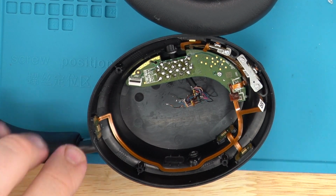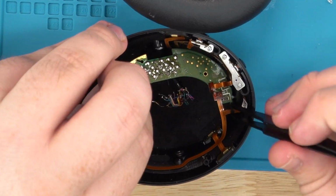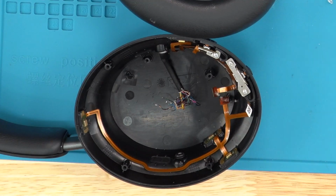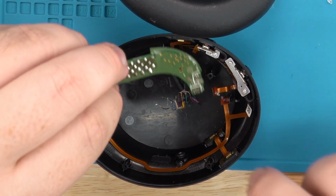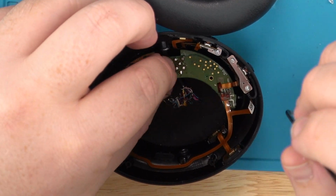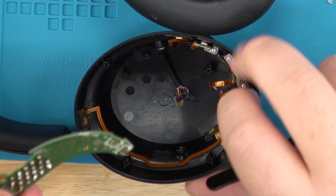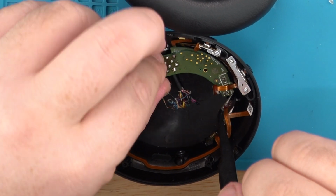Back to the video. It is very annoying, but once you pop that off, you have 1 screw to take off. And then that pops off, glue there, just like that. And here's your right side main board. Take that off, grab your new one. For this instance, I'm using the same one. Place it back, keep these up. And the way you know it's back into position is you get it into that. You'll see a little pin right where you put the screw in, and this tiny hole right there needs to be inside there. Once that's in there, you know you hit the jackpot.